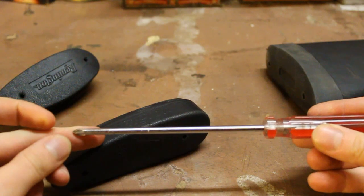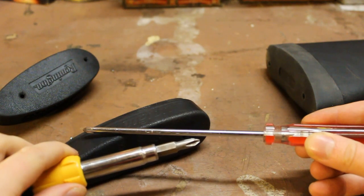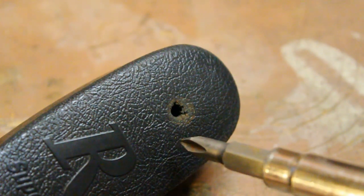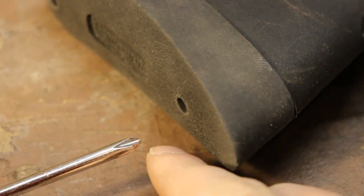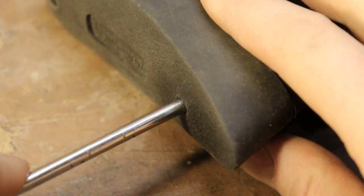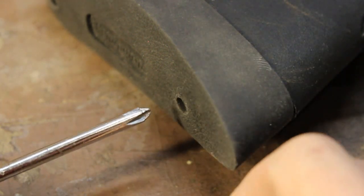1 Phillips screwdriver. I would recommend using a standard screwdriver over one with interchangeable bits. Special long bits with narrow round shafts can work, but your typical interchangeable bit screwdrivers are too wide to fit into these screw holes without tearing or stretching the pad. Make sure that whatever screwdriver or bit you're using has a tip that's in good shape to avoid stripping the screws. You can apply a little oil, grease, or soapy water to the screwdriver shaft to allow it to turn easier inside the pad. I've never needed to do this, but if the holes are really narrow or your tool has a fat shaft, lubricating it can help.